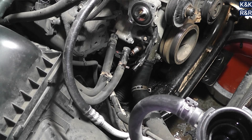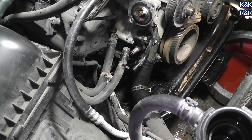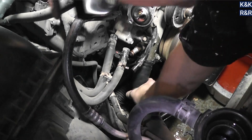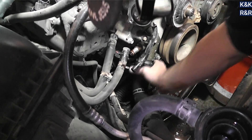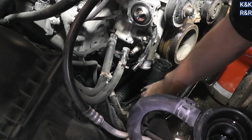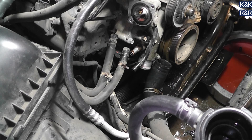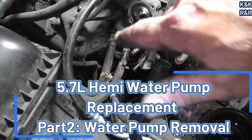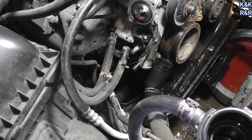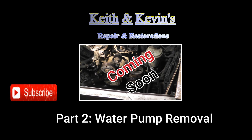As you're going to see, the fluid is pretty pink, so this is actually a mechanical failure. When parts fail you've got to figure out what caused it. I'm going to check the engine hours — this thing might have a lot of idle time. Could have been a bad fan clutch, or just normal wear and tear. But knowing the history on it, I'm going to say it's probably the bad fan clutches. Once the bearing in the fan clutch goes, it starts causing up-and-down movement that jackhammers the water pump bearing. That's when the seal should start leaking fluid to warn you. We might see some seepage when I get the pump off.